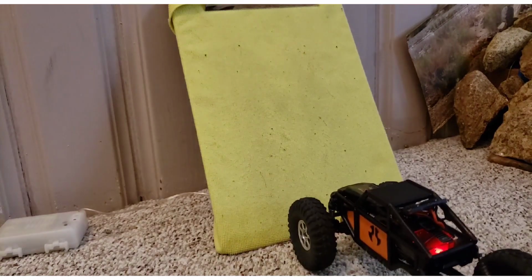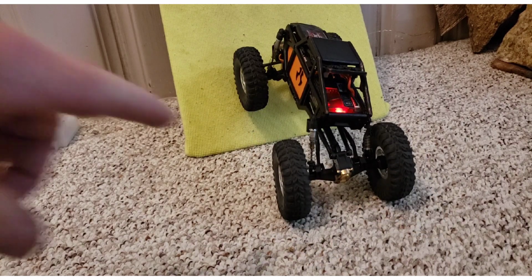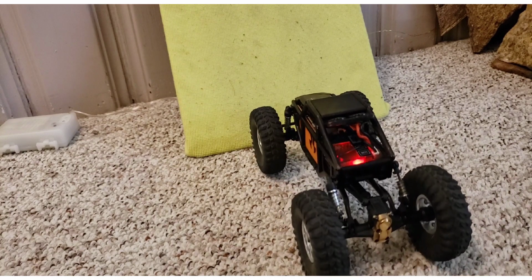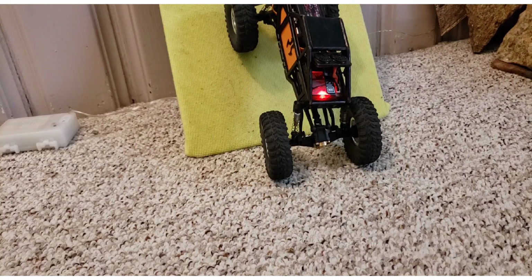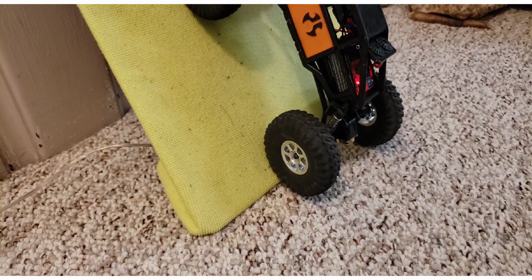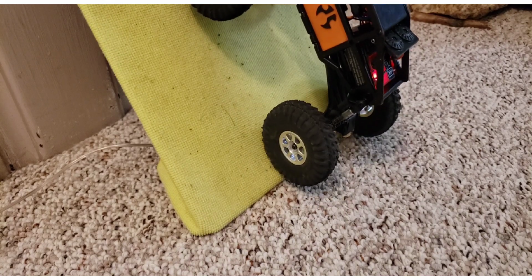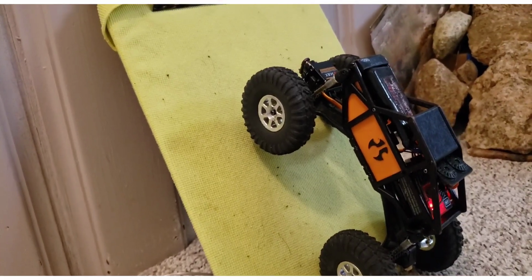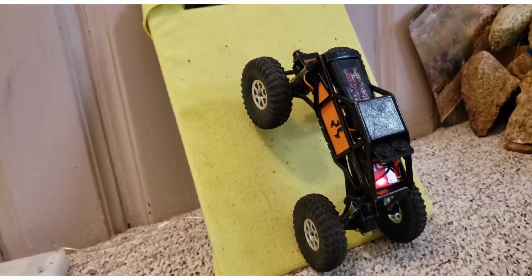Also, when I did that last one, notice as soon as it puts torque on the front tires, that back end rises. You see it rise right here. Watch it again. It sits down. There it goes up. Now watch what happens when the back tires hit the yellow surface. You'll see that the shocks will really stand up now. See that happen? And they stood up for a while. Now the fronts are hyperextended, and it's already lifted the left wheel off of the surface. As soon as you lift a wheel, you're in trouble of flipping. It's imminent.